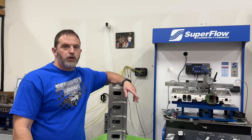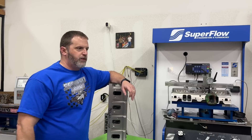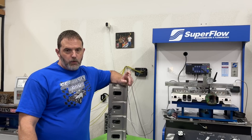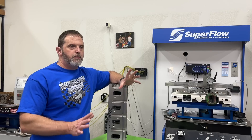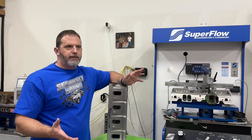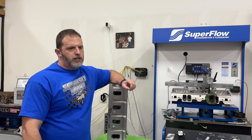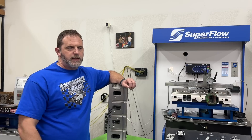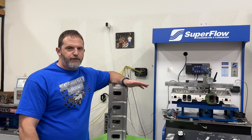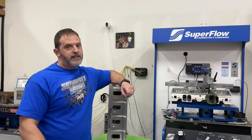Methanol got it to break over 600, with torque being the biggest difference. The next time I tried it was on the 406 dyno mule. We had tried E85 on that as well. One of the major complaints from people in the comments was that both those engines were kind of lower compression — the 355 was 11.9 compression ratio and the 406 was like 11.3. They said you're going to get more advantage from E85 fuel with a higher compression motor, and that is today's test.